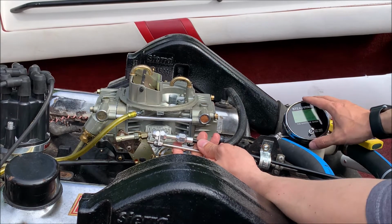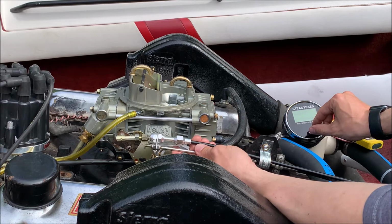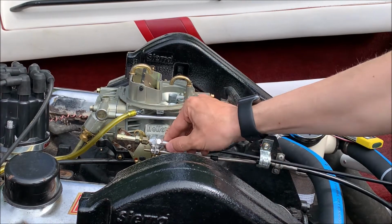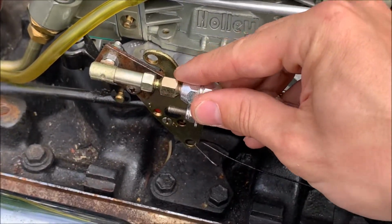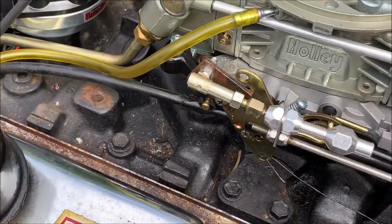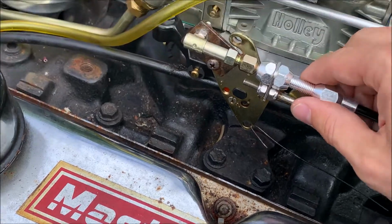The minimum value on the minimum servo menu is 950. I am at 1130. So as I decrease it, you see servo is tightening the cable. You do not want it too tight. So as it comes close, one more click, wiggle it a little bit, one more, it's tight. The moment it's tight, leave it. Do not over tighten the servo. The moment that it's tight, leave it. Worth going back verifying, so 1050, 1060, if there is a slack, 1060 slack, 1050, almost none, 1040 is perfect.